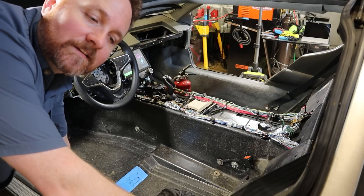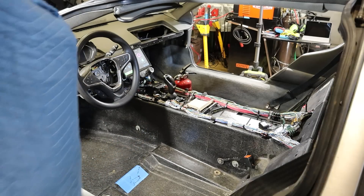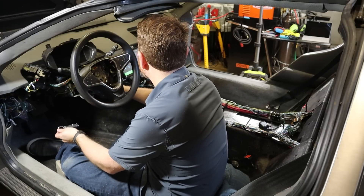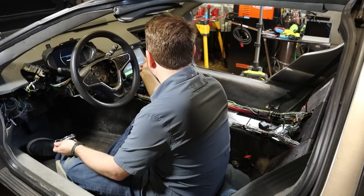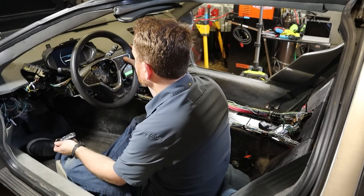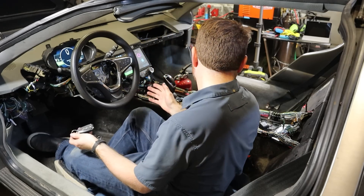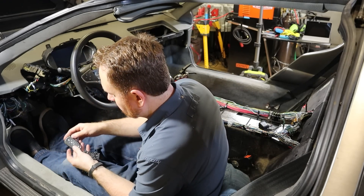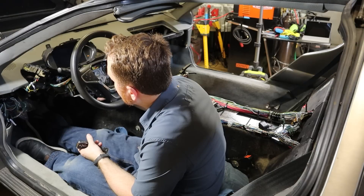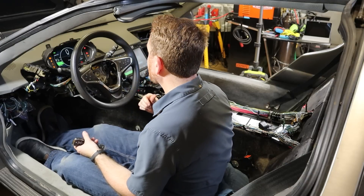I need to go get the key. Got my little key fob here. I'm going to go and hit the button now. It says press brake to start. Bluetooth device didn't come on. Parking brake. Press park to start. Service high voltage charging system. I mean, so far everything is working - the fact that this is working is fantastic. So I'm going to hold the brake now and hit the start button. I have 'initializing, wait to shift.' I heard a contactor click. I see a transmission.